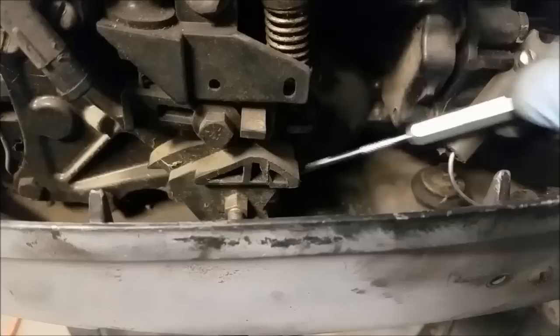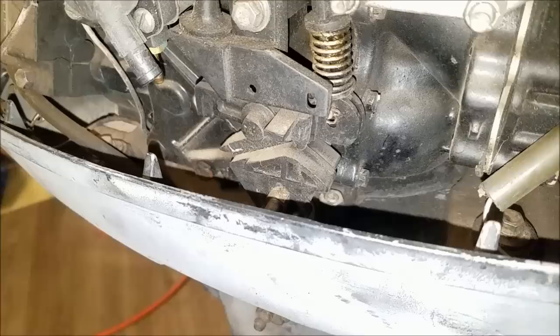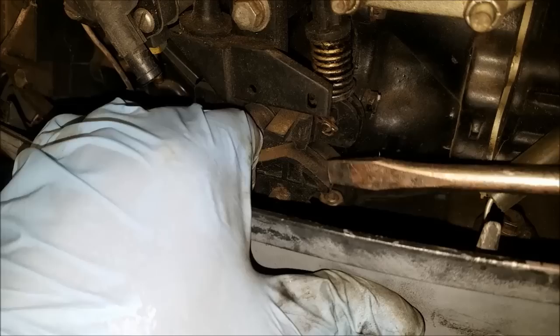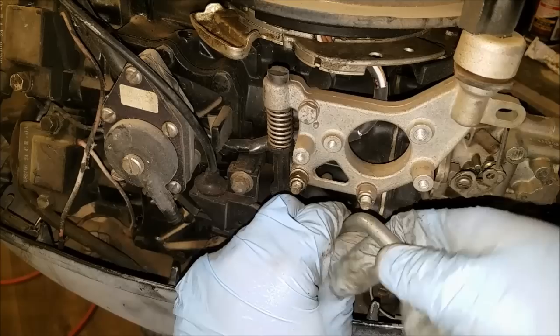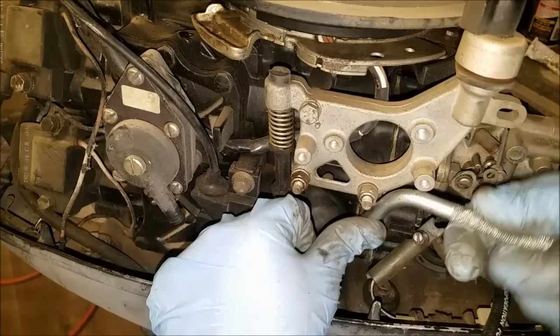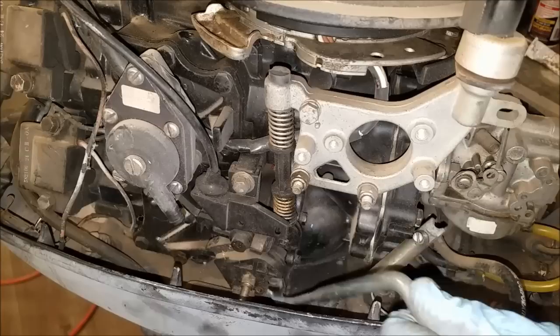So this thing still has all of the manual control stuff on it. There is a rod right here that connects to the shifter which is connected to the exhaust housing — the rod's got to come off so the power head can lift off. Now usually you would remove all this junk to properly remove the power head, but I just popped the rod off, so that's truly all we really care about. There is a specially bent wrench for this, and I will try to include the part number. I've got to get this nut off.